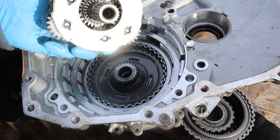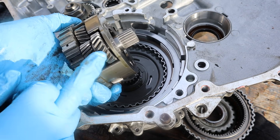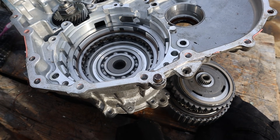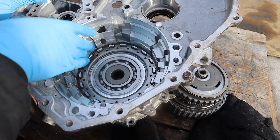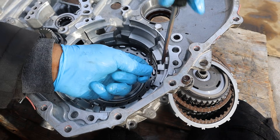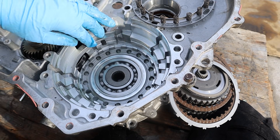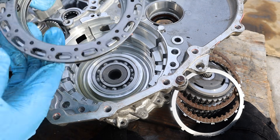Here you can see the planetary gear set — this here is the planet carrier. I took off the ring gear which would attach to these little planets over here, and then we have a sun gear down in between there, spinning along this spline. This planet carrier actually has two ratios of planets — it's got a bigger one and a smaller one. I can pull out the sun gear; it's got its external splines and that's actually splined to this clutch in here. That snap ring went flying in my face, and now I have the last set of brakes — these also brake against the transmission housing, controlling the sun gear. Here we have a return spring for a piston, and a piston inside with a seal and its return spring.